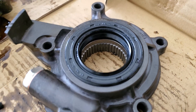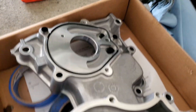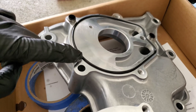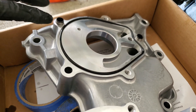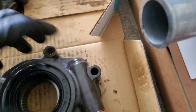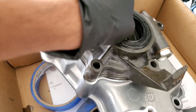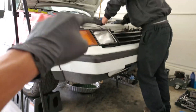The oil seal is now fully installed and ready to be slotted onto the timing cover with a brand new O-ring that's oiled. Make sure the O-ring is not dry — put a little Vaseline or oil on it so that any sharp edges don't accidentally cut it; it'll just roll and slip off instead. We can then fit this with its oil pump gear, slide it in there right on top, and the dowels will help to align it.